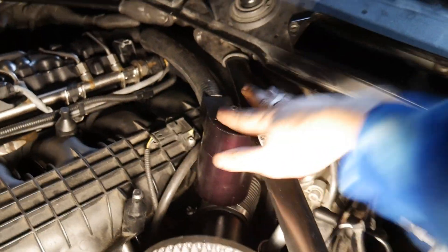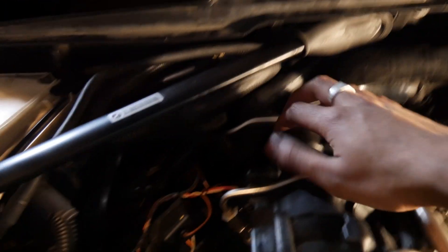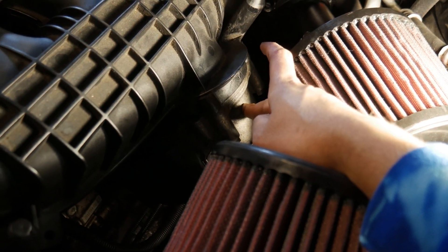So what this vacuum side OCC aims to do is eliminate that need. You have this catch can for high boost and this catch can for vacuum and below boost. It connects right up to the PCV valve right here, bypasses it, goes right into the catch can, and then the other side of the catch can goes into the brake booster line on the throttle body.